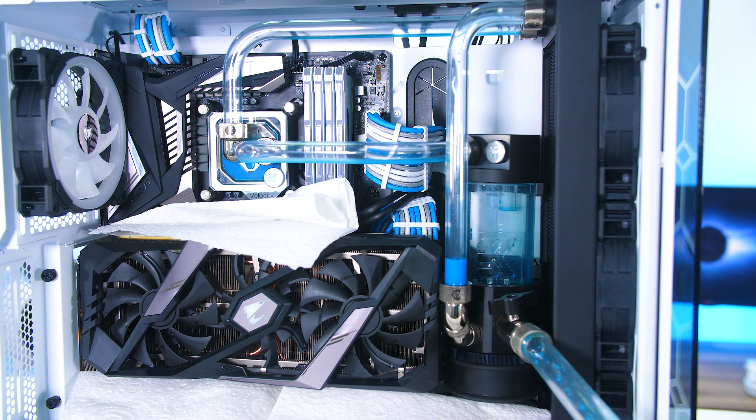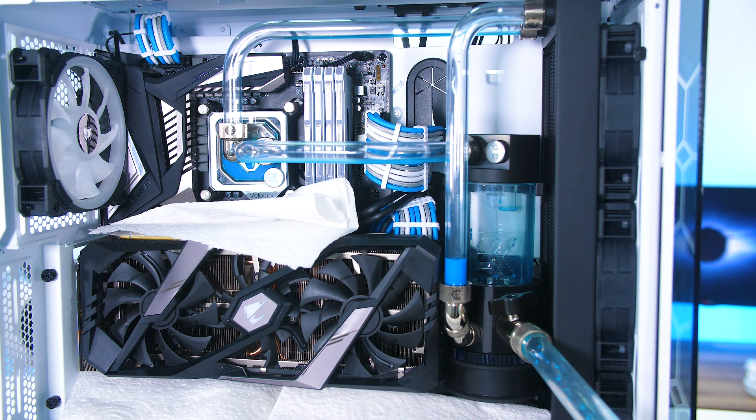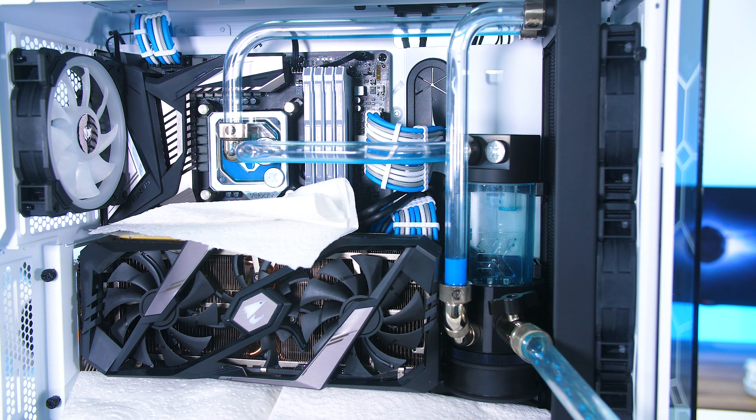Once you take the tubes out, it's straightforward to remove your water block and tip out the remaining liquid, then clean it if needed. If you don't want to take it apart and just want to flush, you can leave everything in place, add distilled water until it runs clear, then drain that. Personally, I like to take my water blocks apart to check on them, and I also fully clean out the pump — sometimes gunk can get stuck in there too.